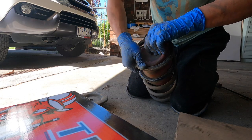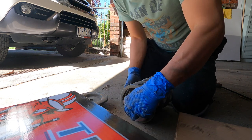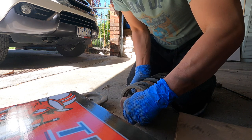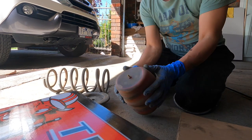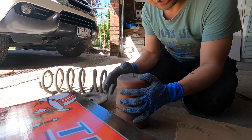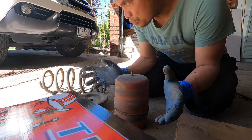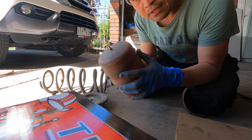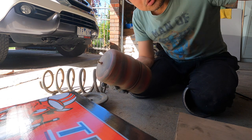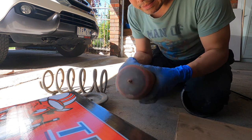It was just in the clamp there. Importantly, this has a bladder. For example, if you're going to use your 4x4 for towing a trailer or camper van, this is what maintains the height of your rear suspension. Your rear suspension absorbs the weight of whatever you are towing. This thing helps absorb that weight so the rear suspension of your 4x4 will not sag. This is very important.